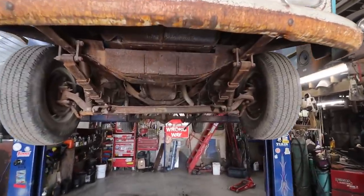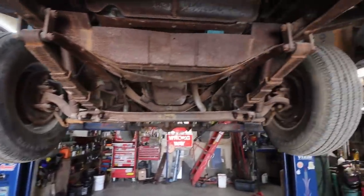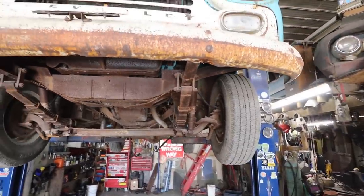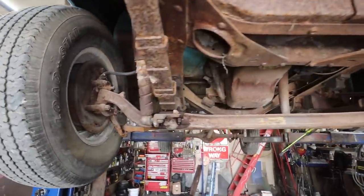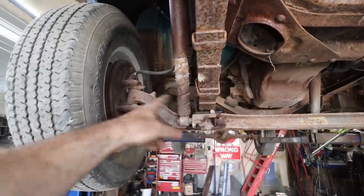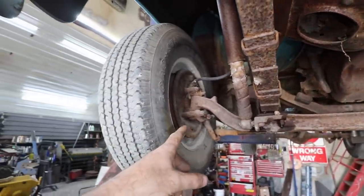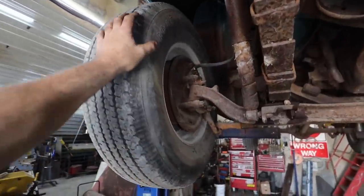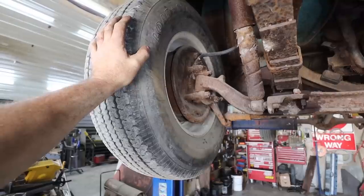I'll have to source some brakes. I actually think I have, now that I think about it. I have an axle around here from a truck like this that I did a clip in. So I bought a 50s Chevy, but I just looked it up, and the kingpins are different widths, and the spring perches are different widths. So if the brake stuff is good, that's going to be a win, because I think that other truck was a driver, so I could probably use the hardware or whatnot.